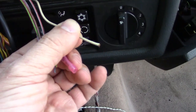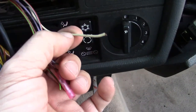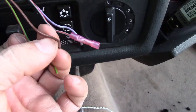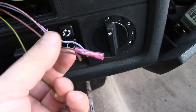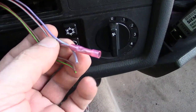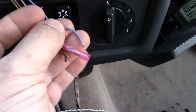The fat white wire is the power antenna — it gets 12 volts from the stereo to move the antenna up and down. The brown wire is ground, goes directly to ground. The violet-gray wire is your switched 12-volt plus from the key; once the key is on, you get power from that violet-gray wire.